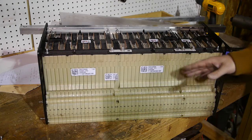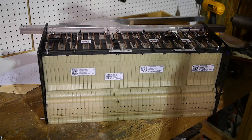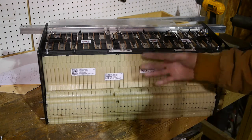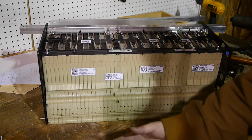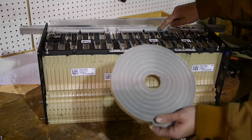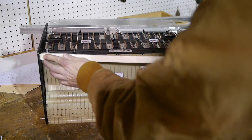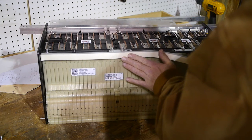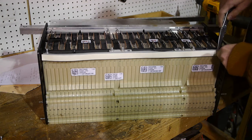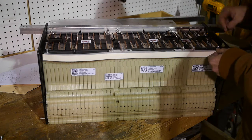Back to the sealing: I wanted to seal this area off. I have a polycarbonate cover — not plexiglass — that goes over the terminals to keep road splash off them. Mud and water get kicked up from the wheels, hit the side, and get trapped in the gap between the rail and the battery. I've already installed the seal on the other side. This is a closed-cell foam seal that's self-adhesive, making installation really easy. I work it down — it's about half-inch thick and I make it a little long so it tucks nicely into the corner with no gap.